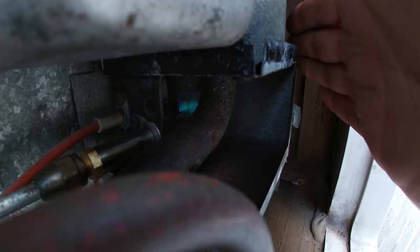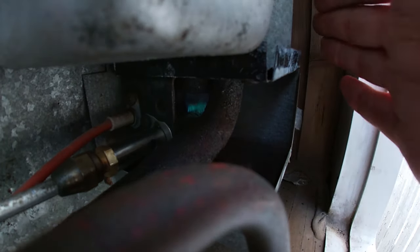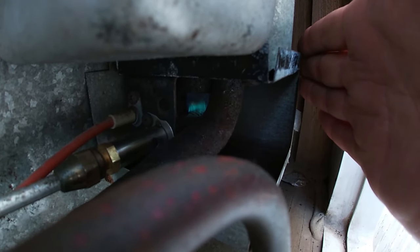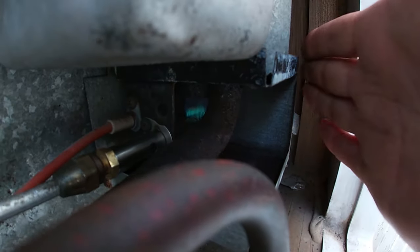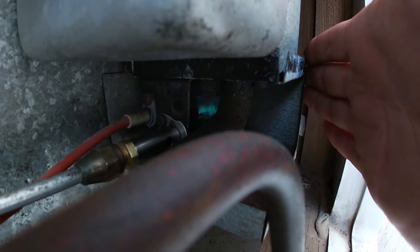If your diffuser is broken like mine was, or you have an oxygenation tube that's plugged or some other issue with the propane burn, then your flame will be orange — it'll have an orange tip on it. That means the mixture between the oxygen and the fuel is wrong, and you will probably not have enough heat to properly run your fridge tube. It's very important.